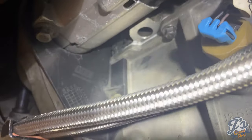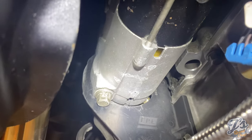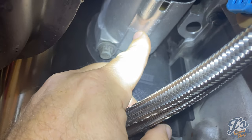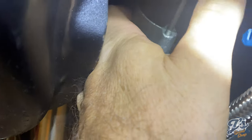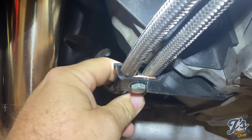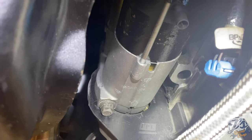Okay, so we've got pretty good access to the starter on this thing. See, this starter's not that old — it was a new unit — but it's got a lot of bubbling in the paint and surface rust. I don't know if that's from the heat. It's pretty close to the header right here — I can see maybe two fingers' width between the starter and the header. So we're going to put that heat wrap on it. Pretty easy to get out — we've loosened up this bracket that holds the transmission lines in place to give a little more flexibility, and then just the two bolts to get it out, plus two electrical connections on the back.